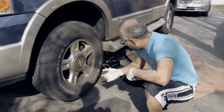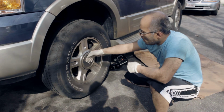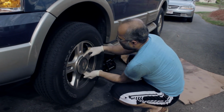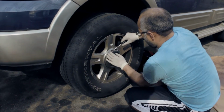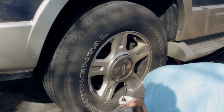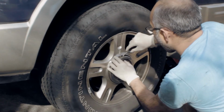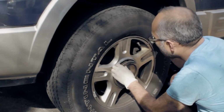After you put the jack and the jack stand, you want to pop up the hubcap to gain access to the bolts for the tire. With these two holes here, just popping it out is basically what you're doing. Bottom, top, top. Yeah, it's giving me a hard time too. It just snaps on though. I'll show you after.